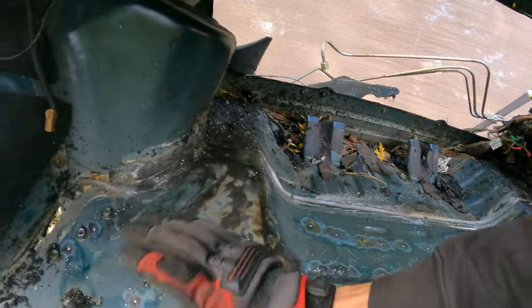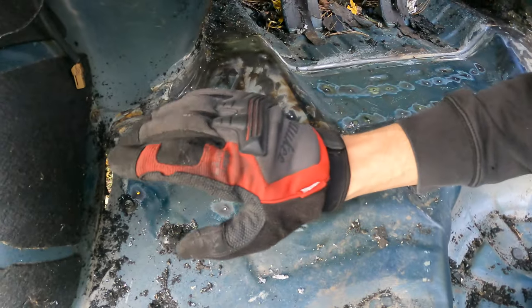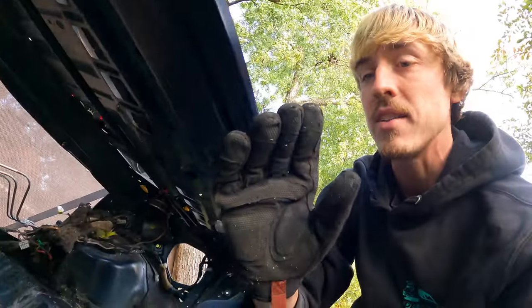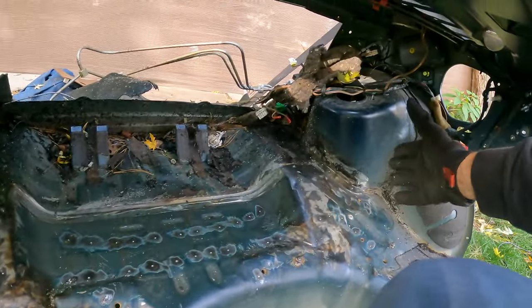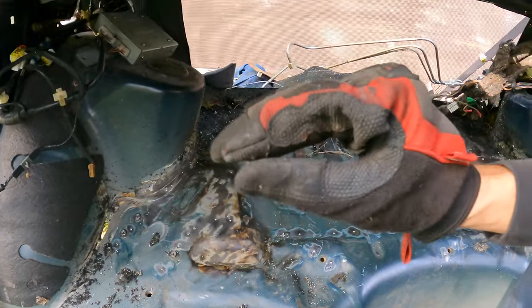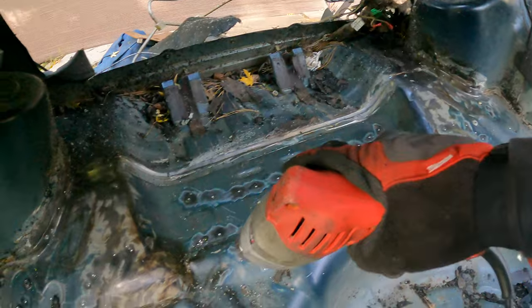Our surface has been prepped and I even went ahead and drilled all the pilot divots on this side — even farther down the frame rails — because I plan on lifting up the floorboard and separating it just a little bit from the frame rails. I don't want to separate it completely all the way back; that's a little unnecessary. I had to chop the frame rails off the Gloria to get the damaged parts off, but I didn't want to chop these frame rails because I want to keep them intact and straight. By separating the tray from the rails I'll have just enough clearance to get it out of the rest of the chassis. These will hopefully be the last spot welds I'll be drilling out on the whole build — which is kind of crazy to think.